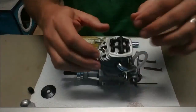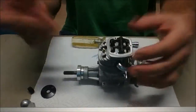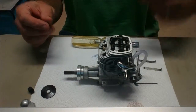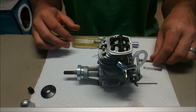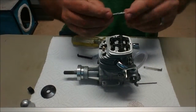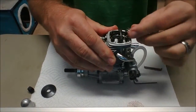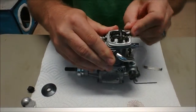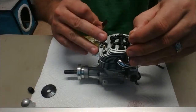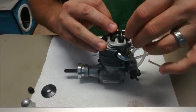So I can check my valves. Since I've had this engine apart, there's a 50/50 shot that I've got the exhaust and intake rocker arm in the wrong spot, so I need to check them anyway. I've got a little wrench here — it just so happens to be a 15/64, I don't have the metric equivalent — and I'm just going to break loose these locking nuts, then with a small Allen key I'll get it engaged in the top of the set screw.